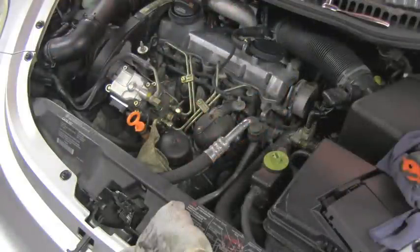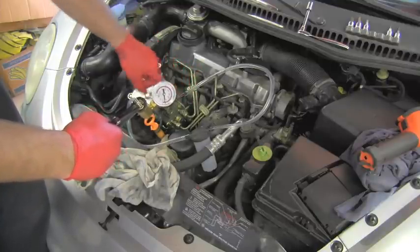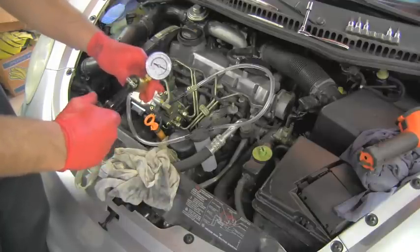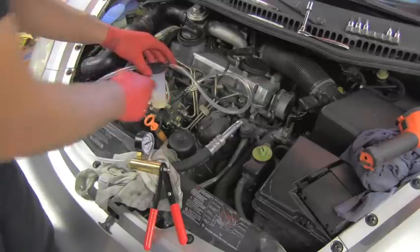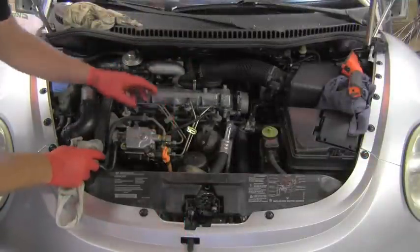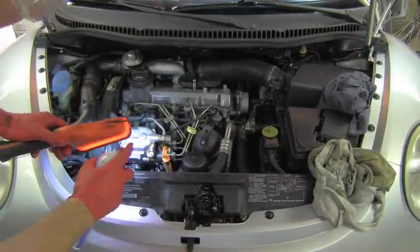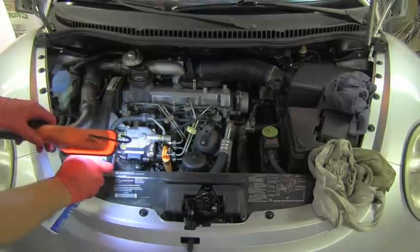Everything is nicely together but something's missing — the fuel in the injection pump. I'll be using my vacuum pump connected to that fuel return line down there, drawing fuel into the injection pump until it's full. I can see the fuel is already in the pump. This is all fuel so I'm ready to disconnect it and put that return line back in place. Everything is hooked together and I can remove all my tools and rags.